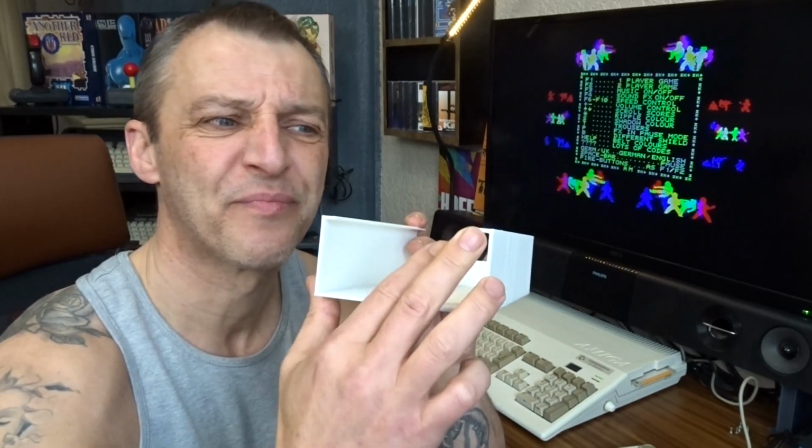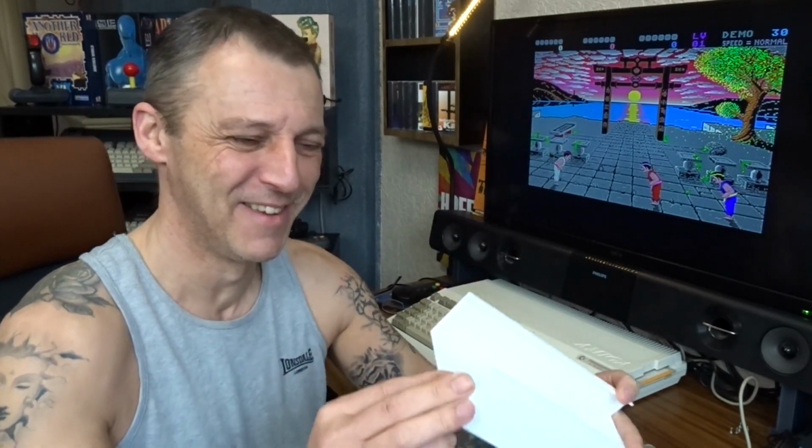Yeah, I measured it wrong. Well, I didn't, I measured it right. 3mm wall all the way around, solid infill, printed at 0.15, so quite fine. It still needs a bit of sanding. These bottom 2 lips, I didn't take into account the 3mm of these. A little bit too tight. So yeah, 9 hours wasted.